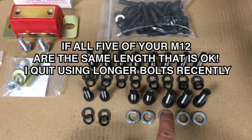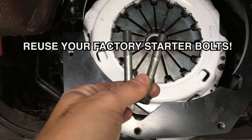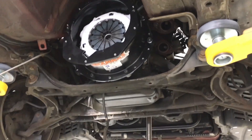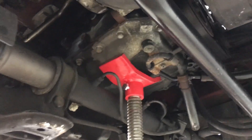There are three larger ones on the sides and two at the top. For the starter, you're going to reuse your factory unit. One thing you're going to want to do is get some sort of stand or jack — if you're on the ground it's a lot more difficult, but getting the front end of that motor jacked up in the air will make your life easier. I'm using an exhaust stand going right up under the front of the oil pan.